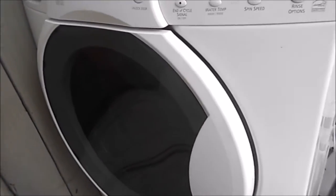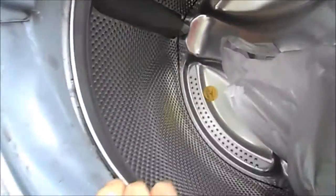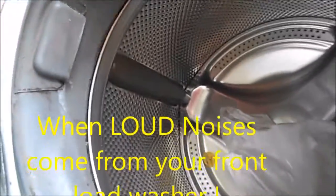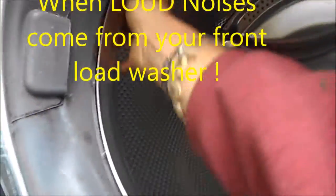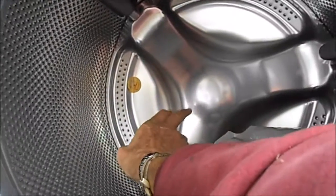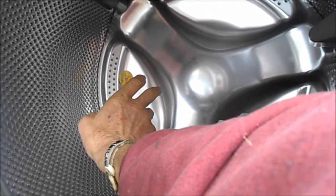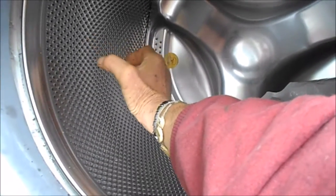You're gonna see a video of the actual basket — this is not the same basket, it's very similar. You can see this basket is toast due to the bearing; we've got debris here and a lot of slop — this is definitely noticeable slop. There's a difference between the shock absorber action and the bearing slop; you can usually hear a noise when you hear the bearing slop. You have to pull the back pulley off in order to separate the two halves of the tub in order to slide the whole thing out to replace the bearing.